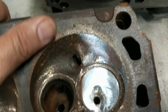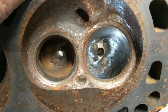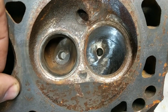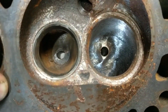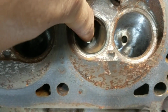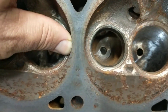But you can see on here, just widen the bowl a little bit and get a nice smooth transition into the chamber, narrow the valve guide some, and make a little teardrop shape. Like I said, these aren't done. They're just kind of roughed in with a burr. I hadn't done the sanding rolls or anything yet. And then on this bowl, just kind of lay that back a little bit so you don't have that flat spot that the exhaust is hitting.